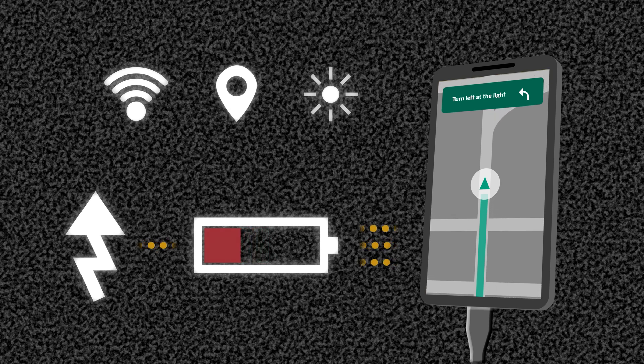Depending on the shape of your phone, that may not be enough. The rear seat chargers are interesting — an easy solution you can give your customer if they have a charging problem is just try running the charging cable to one of the back seats. Those back seat dedicated power chargers are often more inexpensive to buy at scale for manufacturers than a combined data/charge port. You may find a slower charging data port up near the front of the vehicle in order to communicate with the infotainment center. For dedicated charging, the rear seat is often your better bet. If your battery's starting to go, it just doesn't hold a charge as easily and takes more current to build up that charge.